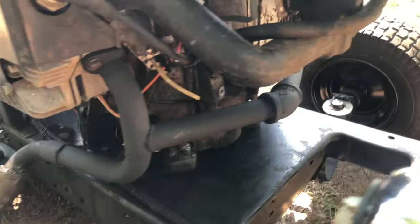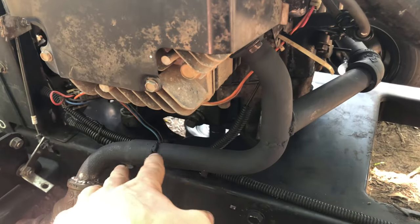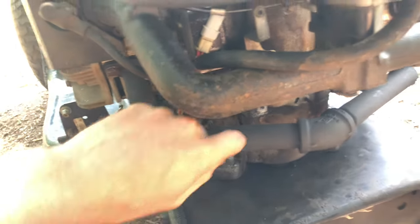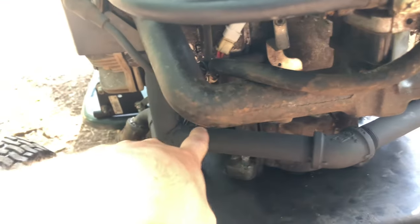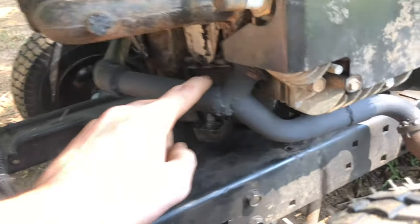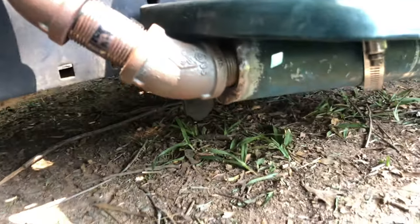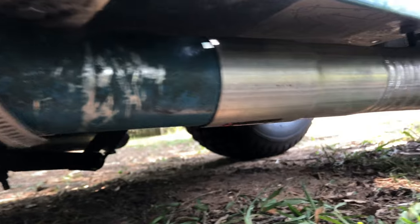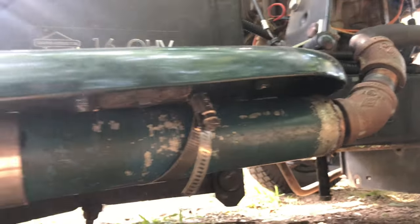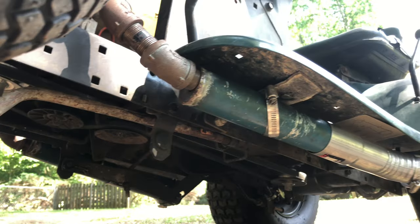The other thing obviously not stock is the exhaust. I have about two videos on this, but basically these were the original headers — I cut and re-welded them into these pipes. I drilled a hole in the center part and welded in a pipe to conjoin the two pipes together. It runs out the side through three-quarter inch pipes into a two-inch pipe, hose clamped, with turnouts running out the side — same on both sides. It gets rid of all the popping noises and all you hear is the low tone of the engine.